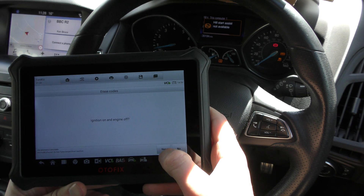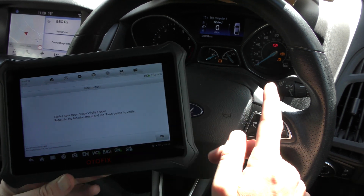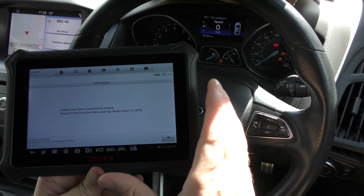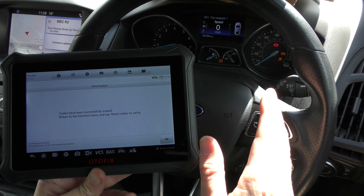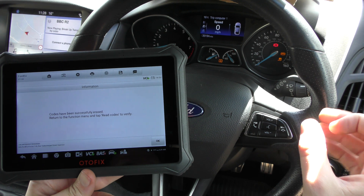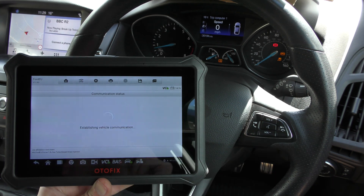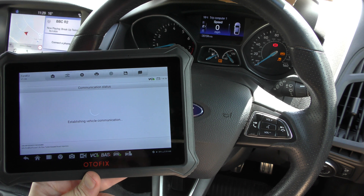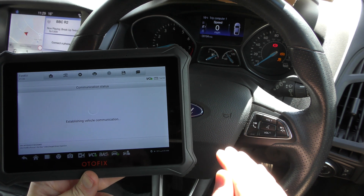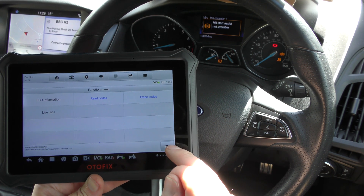We're going to try and erase the fault codes now. We click yes. Now it's telling us on screen that the codes have been successfully erased, but you can see that the warning lights are still on. This tool can only do so much, and it doesn't matter whether you've got a £100 tool or a £1,000 tool — the tool can only do so much. It can send the information to the ECU to say we think we've fixed this fault, but on the other side of that, the ECU or module will do a quick scan, and if it's not fixed, it's going to keep the warning lights on and keep the codes in the memory bank. We'll go back into read codes, and you'll probably find that the fault codes are still there, because the ABS module has completely refused to turn off the warning lights and refused to remove the fault code. That is just really how it works.